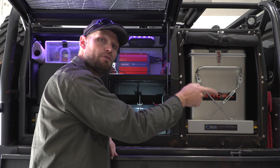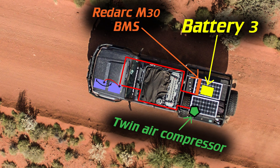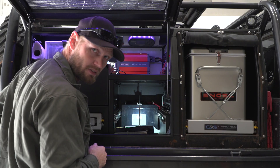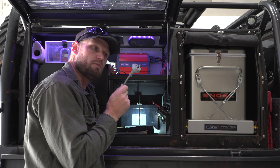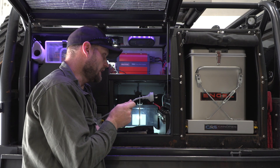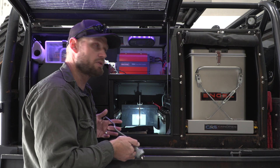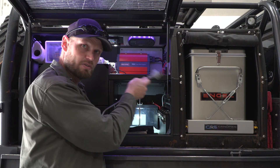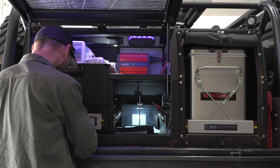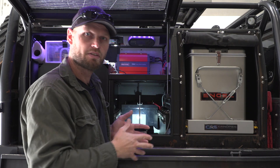The Manager 30 can charge your battery from solar, from the front alternator or batteries — it detects the alternator charge through the wire running to the rear. With the car switched on it'll draw 30 amps from the front. It's also AC compatible, so I can plug it into a household point at home and pre-charge the battery for a trip, or if leaving the vehicle parked for a couple of days I can keep the battery topped up and the fridges cold.